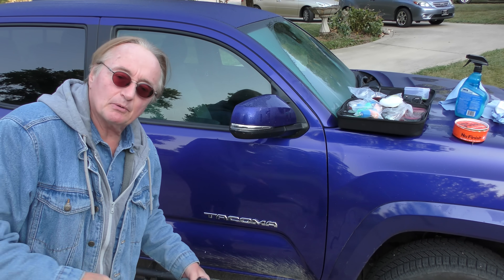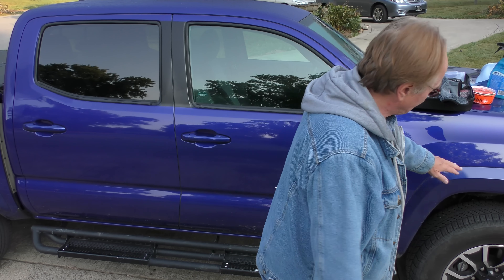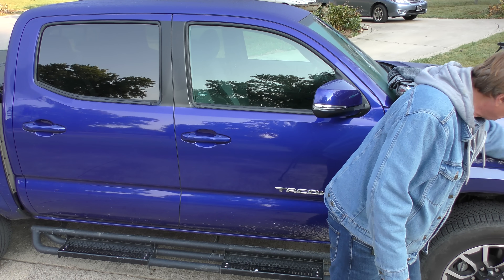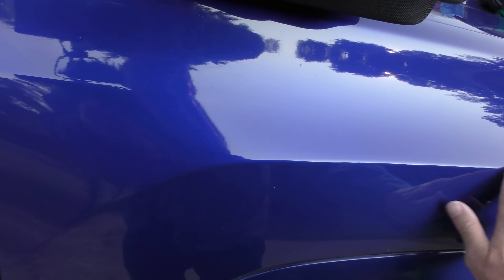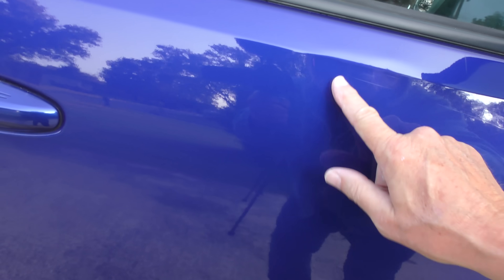Now normally after polishing you want to wax the car. My son looked at his truck and whined — he says you can see all the dings. Well that's the problem: if you're going to polish a vehicle and it has dents, those dents are going to stand out because now they're shiny. This part wasn't hit by the tree and the lines are smooth, so you can polish to your heart's content. But where the tree branch hit right here, you can see all the dents — it worked great over here where they were basically just scratches on a flat surface.